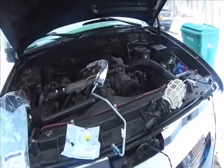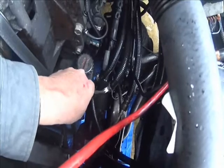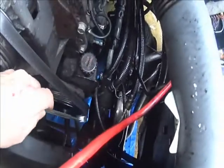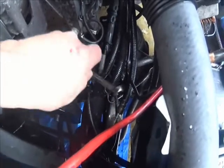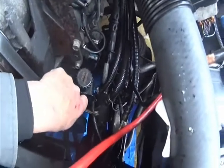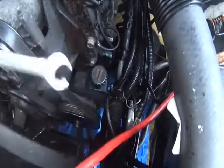The one we're going after is this one right here — it's leaking right where it's crimped on. You can see all the fluid everywhere. I pressure washed what I could so I can find which one it was. This is your return line — that's why there's a clamp on it, it's not under pressure. This other one is the high pressure line that comes back from the hydro boost up to the steering box, and then another one goes back into the pump — that's the return from your steering box. So we've got to go after this one, and the nut is on the bottom side, so let's get under it.